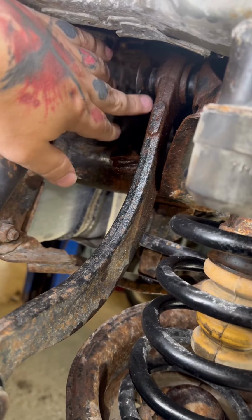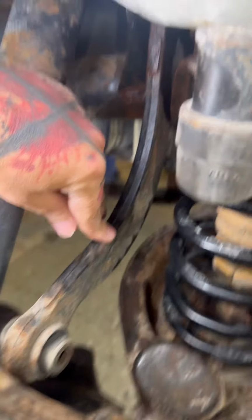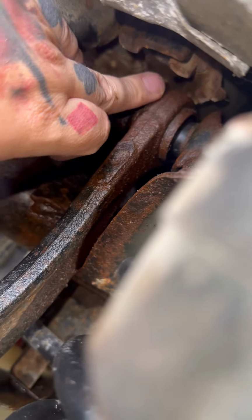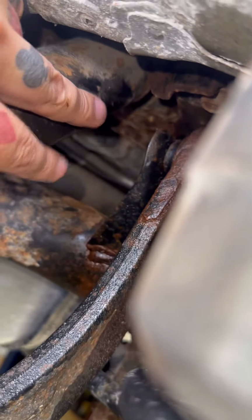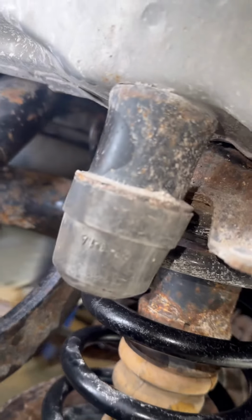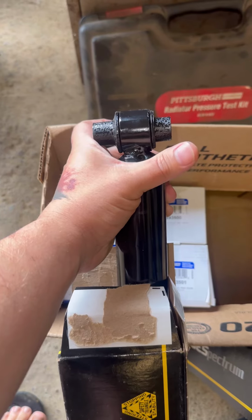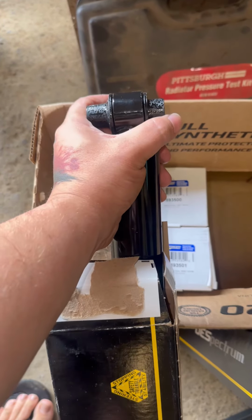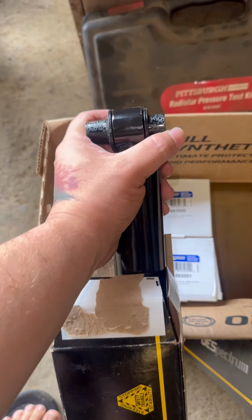Now we got that bolt out. This control arm, upper, can get out of the way. Now we can get to this bolt right here. You gotta take those 3 bolts off the bracket, the shock mount bracket. Then it can all come down in one piece. Then in that bracket, there's a bolt going straight through here. Change it over with the bracket off the vehicle.